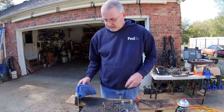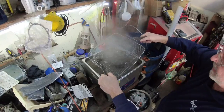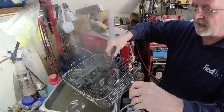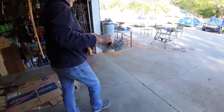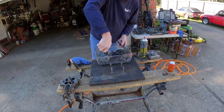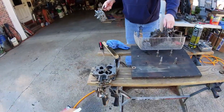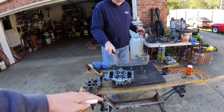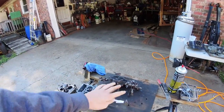We're going to take the base out of the ultrasonic now. Here's another thing - here's the board with the studs on it. On the Nikkies and Hollies as well, the linkages hang below the base plate of the carb, so you can't actually set it down on a flat surface and have it sit level. Charles made that board so he can build his carburetors on it.